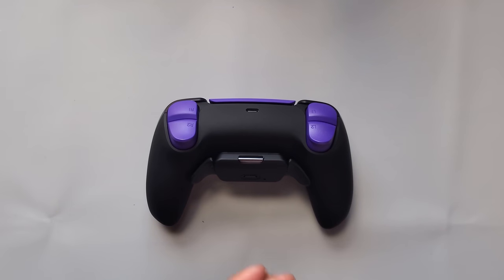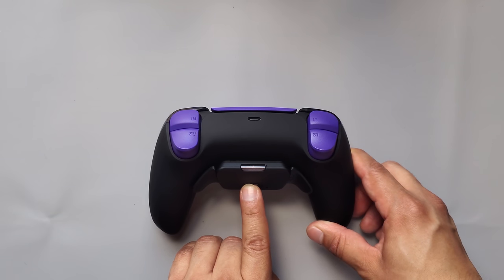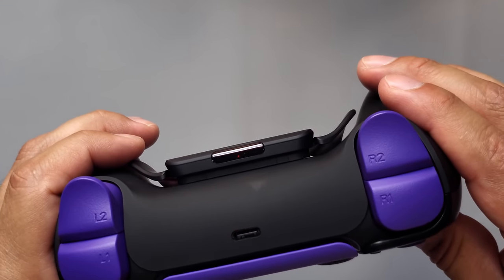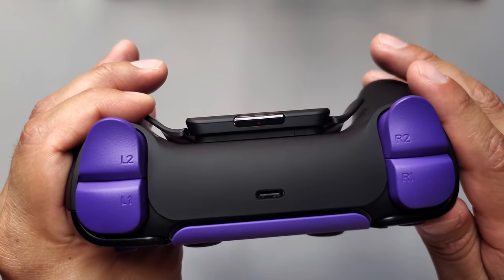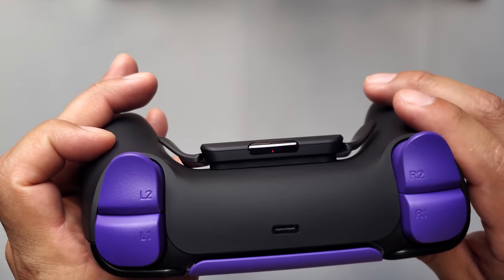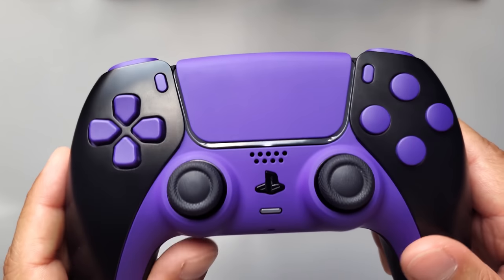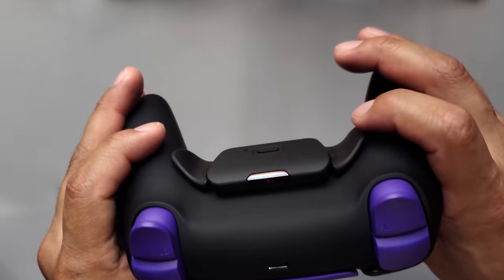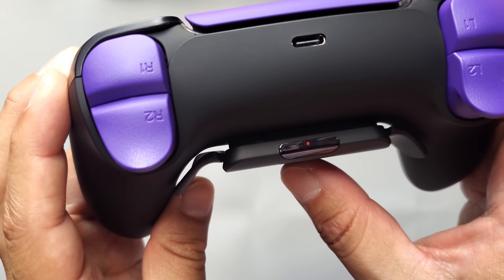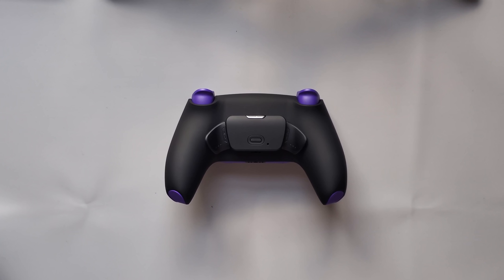The controller is fully assembled again. To turn your back buttons on or off, hold the button here for about three to five seconds and a little red light will come on. To reprogram: let's choose the left button and circle — press the two together and watch for the red light to blink. That means the left button is now mapped to circle. Now I'll choose X and the right paddle — hold them down together and the red light will blink again. Your back buttons are ready to use: this one is programmed to X, this one to circle, and it has a nice clicky sound. Make sure to shut it off by holding the button down until the light goes off.